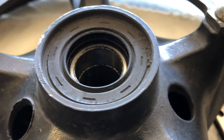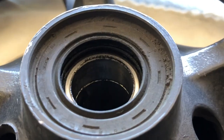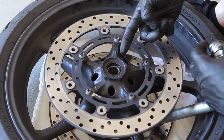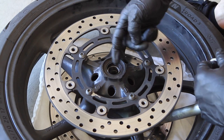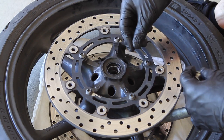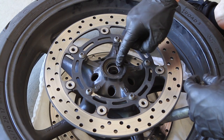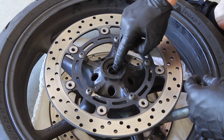This is the oil seal here that we are going to be cleaning and lubricating. It's rather dirty from riding in all weather. Now that we've got the front wheel off, we can grease and lubricate the front wheel oil seals. The manual doesn't actually have a scheduled maintenance item for greasing the front wheel bearings themselves, but they do say to lubricate the oil seals here.